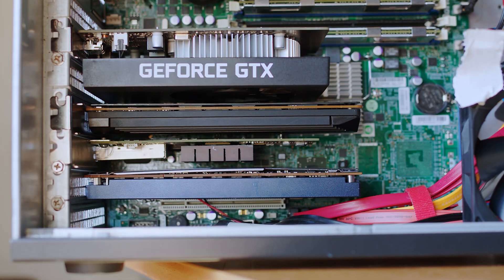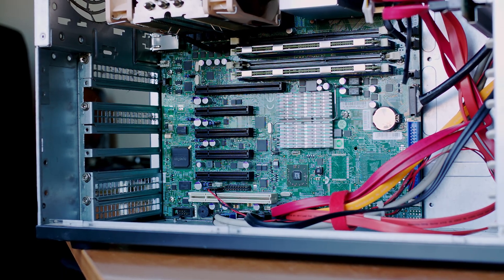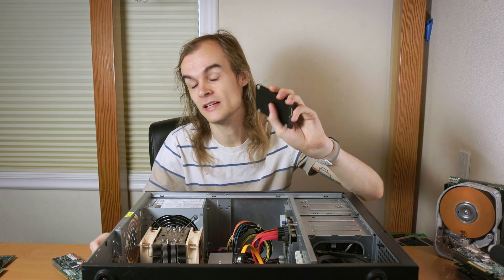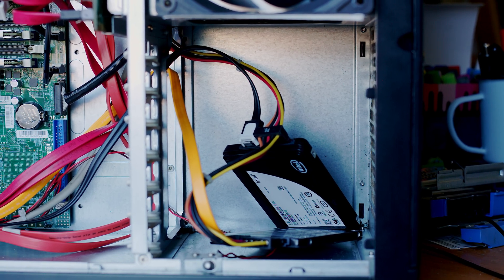I know this is an older Gen 2 PCIe system, so it won't be utilized to its full extent, but it should still have a quite large advantage in low latency performance compared to any other NAND drive, even in an older system like this. This still leaves me with an old school PCI slot open, but there's not much I could want to use in PCI these days. I still have two SATA ports open. I'm going to put in an 80 gigabyte SSD as a boot drive, and then a 1 terabyte Samsung 870 Evo as a storage drive for other data, VMs, or anything else.